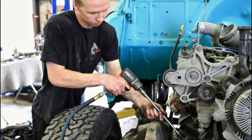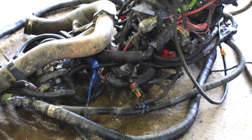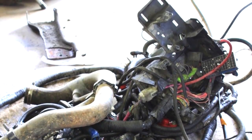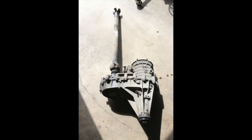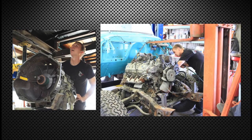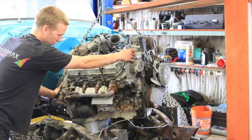Pulling the engine out of the donor Apache is a pretty straightforward process. First, Owen's going to take whatever remaining pieces are connected to the engine — radiator hose, wiring harness, that kind of stuff — and just get that out of the way. Next he's going to put the truck up, drop the transfer case, pull the ZF trans off, put the truck back down, get the forklift out, hook everything up, buzz those last couple of motor mount bolts loose and pull that thing out with the forklift.